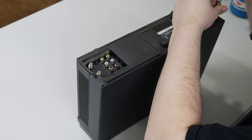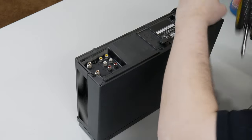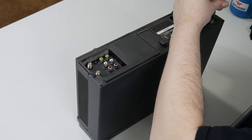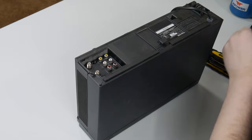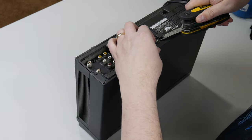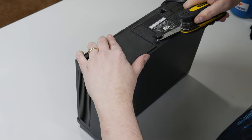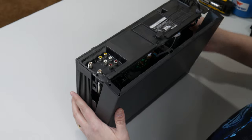Not completely—you just need to get the case off the top. Usually it's a single metal piece, or it might be one half of plastic. It's as easy as removing the screws and not too terribly difficult. Sometimes you have to lift up a little tab in order to get the top off. Here you can see me doing just that with this donor VCR, and once you're done with that, you'll be ready to start.